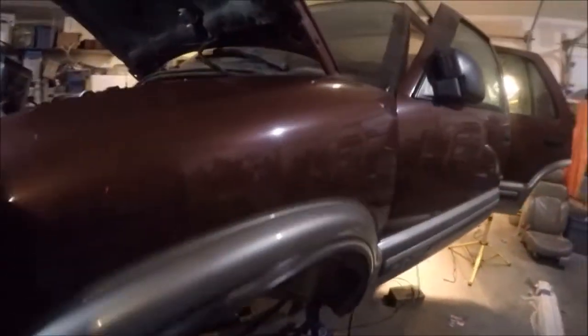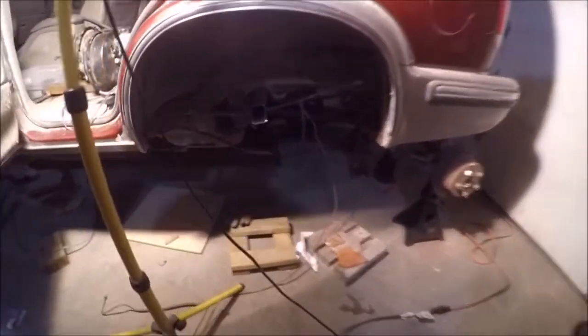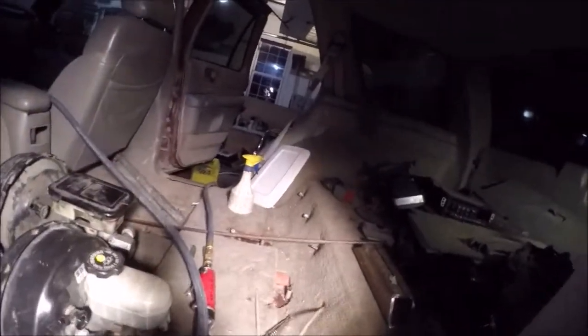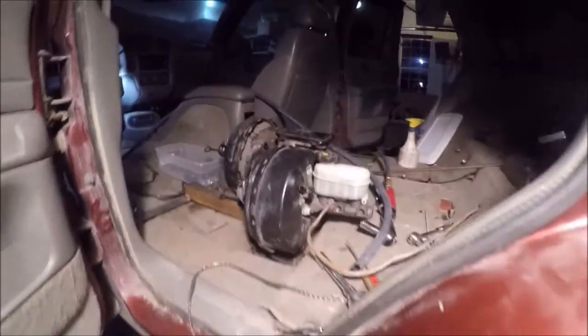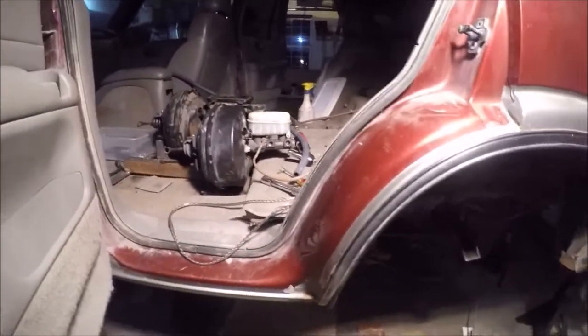What we've done so far - I've been working on the brakes. One of the problems is we've got to run brake lines down to the calipers installed in the back. This brake line is off another Blazer, but the hose on the end goes into a different size fitting. I drilled the hole and of course it's not the right size - it actually goes into a distribution block in the ABS module, so that's where the size changes.